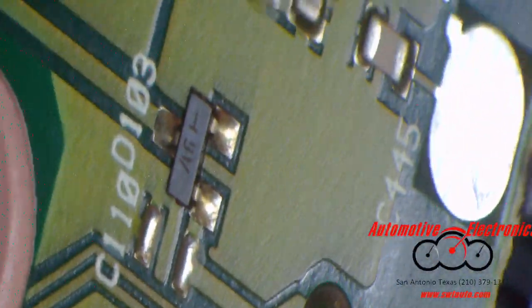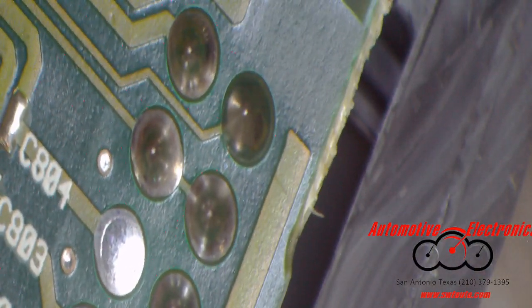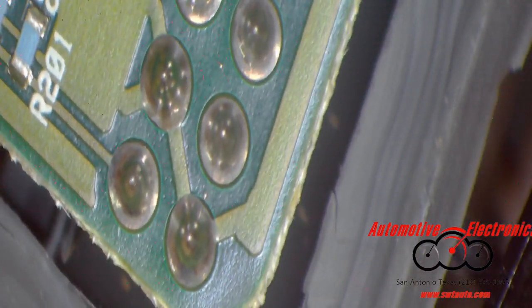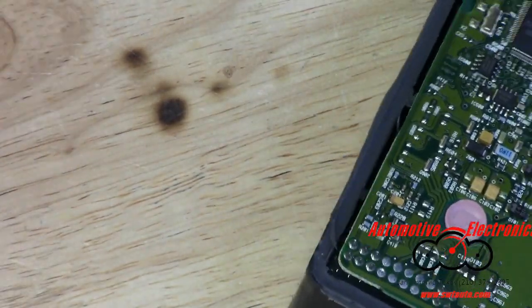Let me check these header pins. These two don't look horrible either. I'll take these two in the middle here. I usually put my finger over these things to find them since it's bigger. Got a little bit of some stress cracks going on there. Perhaps this was more of a situation where he was having a bit of an intermittent issue instead of a total failure.